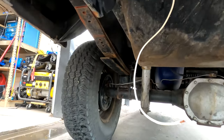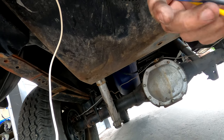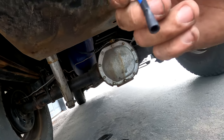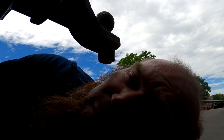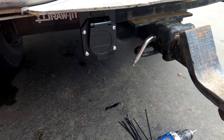I need to run the wire back for the brake controller — it's hanging right here — and bring it back to the wiring harness that the plug is going to be plugged into. We grab the blue wire that already has the connector, stick it in, crimp it down, and we're good. All we have to do is get a self-tapper for the ground and put it somewhere grounded. We're going to save the black and yellow wires for the power wire and auxiliary power for reverse lights later if needed.